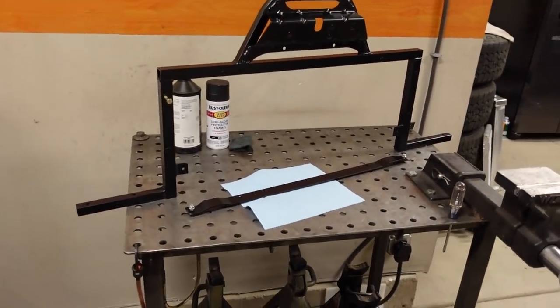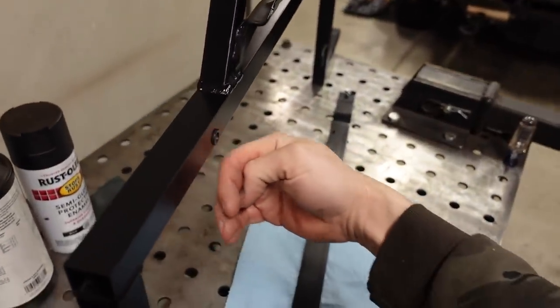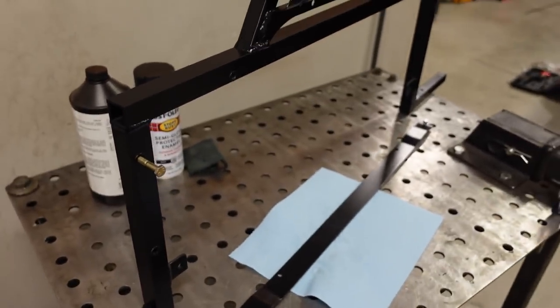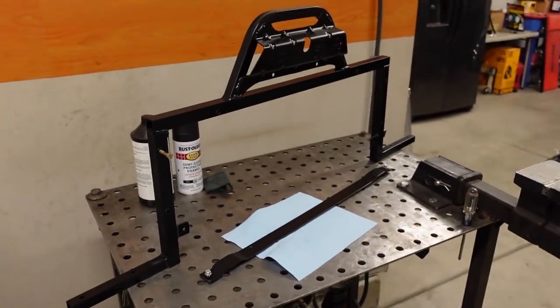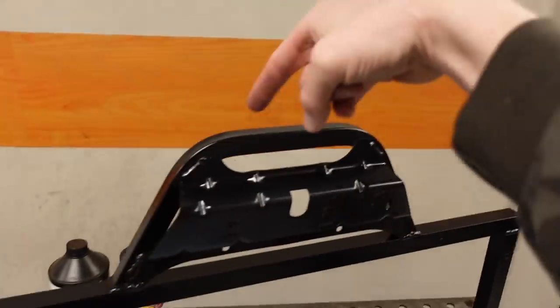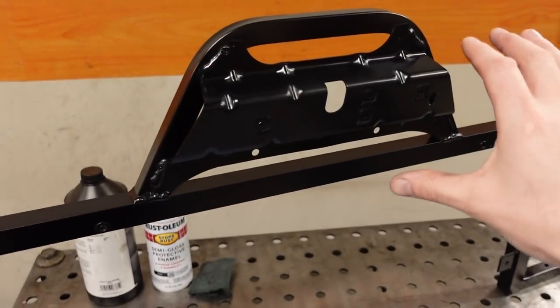Overall, it moves the transmission cooler back by about 3 inches. It now sits perfectly flush, underneath the bracket here. That leaves plenty of space for the heat exchanger to sit up front. It still uses all of the factory mounting positions. There's two holes here, two on the back side there, two down on that side. The factory hood latch still works and it'll clear everything.